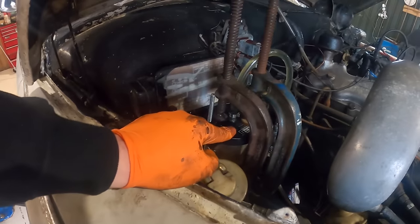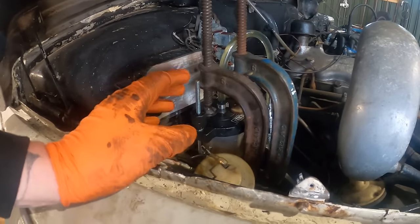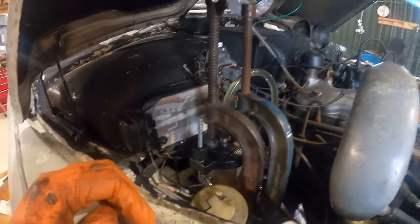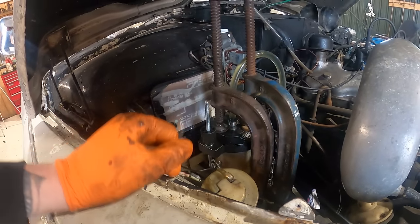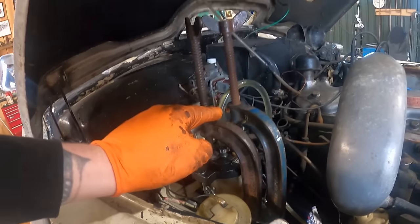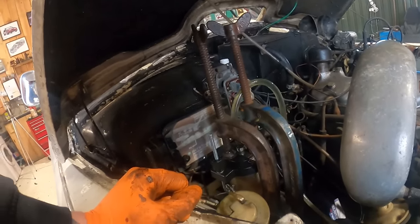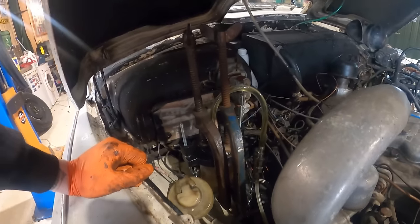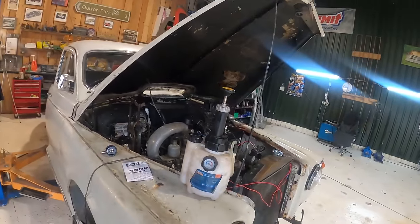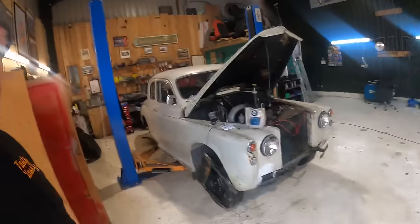So they sell this, which is essentially a clamp-on cap that attaches to the brake bleeding system, but it just doesn't work. What you end up doing is tightening everything down here and it all just spilling out the edges. So fortunately, I've got two very large C-clamps which I've fitted, and now it has stopped leaking brake fluid and I've been able to build up 15 psi of pressure, which I'm now going to use to bleed the entire brake system on the car.